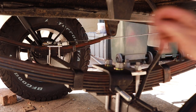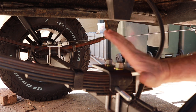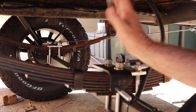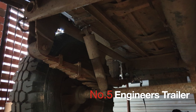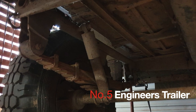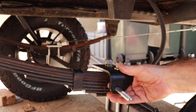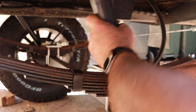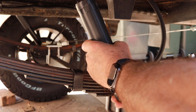We've got our bottom bracket on and we really didn't have a lot of say in where our bottom mount is — where we do have say is where our top mount is. Looking at a lot of these old army trailers, there was one made with shock absorbers where they drilled through the top tube and mounted the top mount there, so we're doing the same here. If it was alright for them, it's alright for me. The first thought might be to just put the shock on at fifteen degrees, drill the mount and go — but that's not quite right.